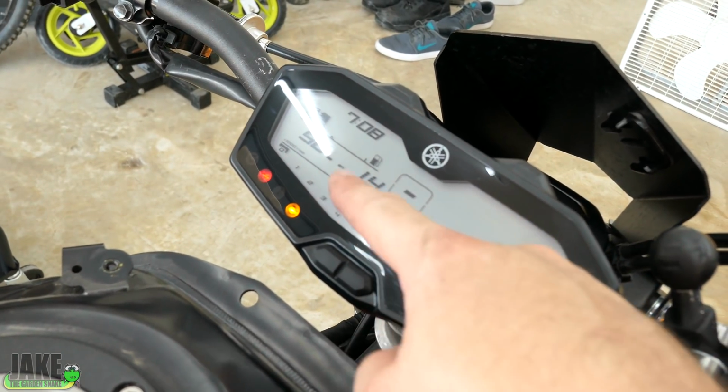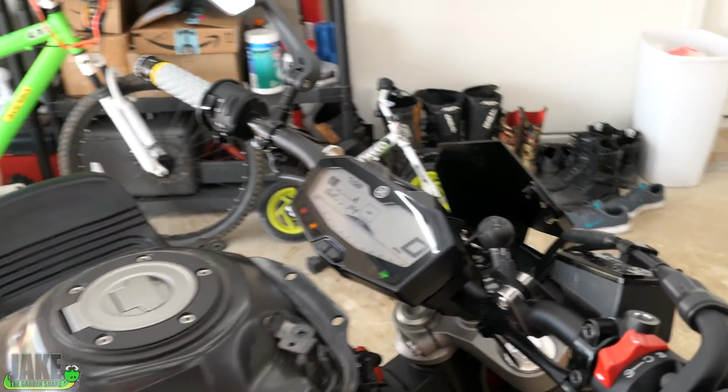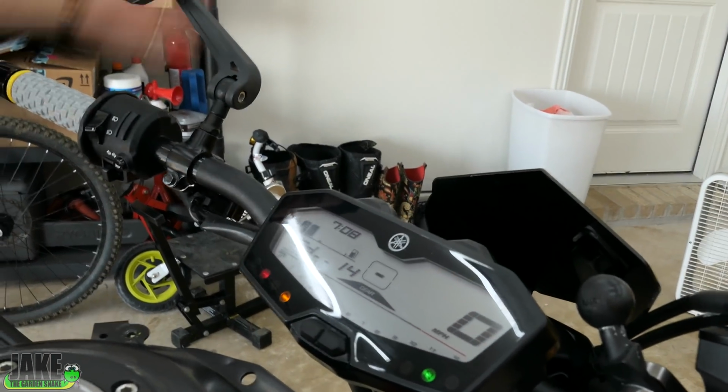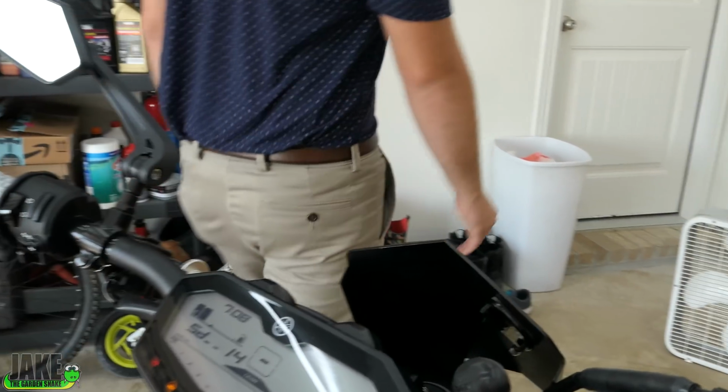And we looked it up, and this means that it has the... explain again, Ian? This means that the intake air pressure sensor is either clogged or detached. Which it is detached right now. It is detached, so actually this is an expected thing, and it's good that it came in. It means that it's working properly. Yeah, so that's fine right now. We'll probably just reset everything when we're done. I'll probably just do a battery reset, but we can ignore that for now.